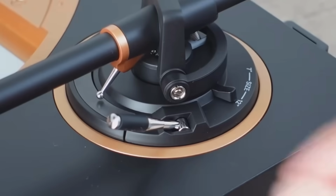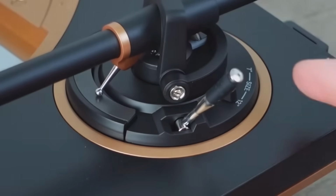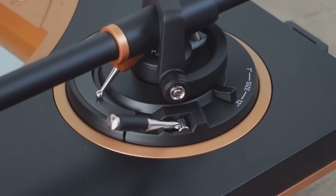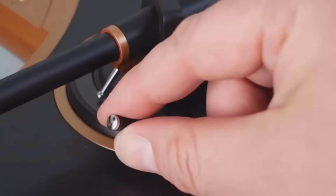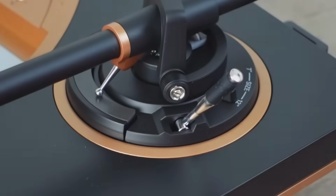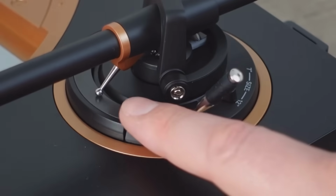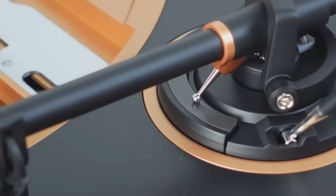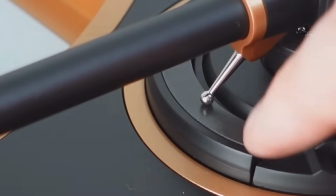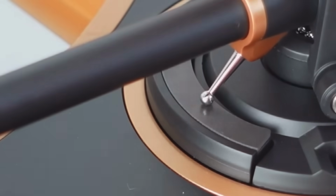has sort of a peg leg coming down from the tone arm that rests on a lower shelf. So you've got this lower shelf and this peg leg coming down here, and the shelf lifts and lowers it, and that is how it achieves the cueing lever effect that it needs. Because it is fully automatic, it has to have the full range of travel of that tone arm, so it's curved around the base of the gimbal.